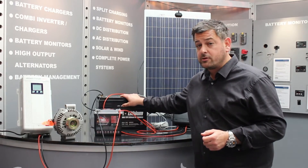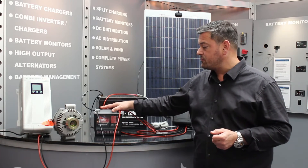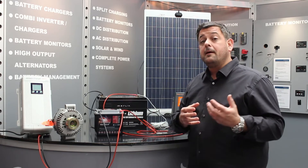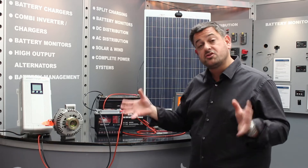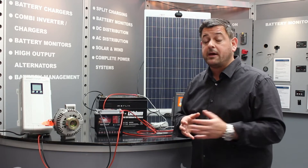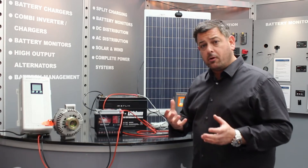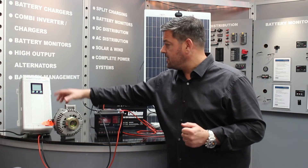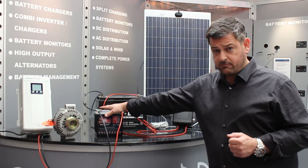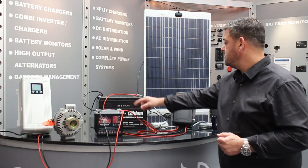For this demo, I've used our Parcel lithium 100 ampere-hour battery — this is subject to another YouTube video we've done — and also one of our Full River full-throttle pure-lead engine start batteries. This little battery is capable of sitting in a freezer overnight and jump-starting a full Transit. What that means for people who are building RVs or for boats is that you don't need to cart around such large engine start batteries just to start the engine. You can put one of these in instead and use that additional space either for payload or for a larger battery bank. It is conventional technology — it's a standard AGM battery. What we've got set up is the engine alternator; in this case I'm using a 60-amp battery charger to emulate the engine alternator. This is charging the engine start battery directly. We then have a power feed from the engine start battery to our DC-DC charger, and from our DC-DC charger to our lithium-ion battery.